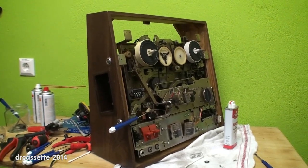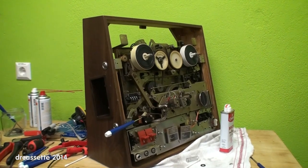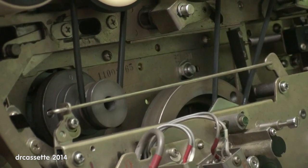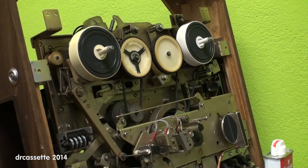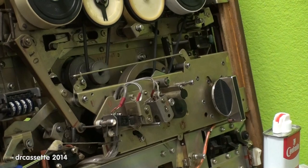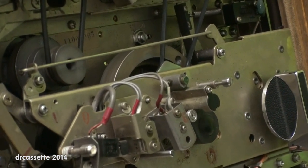As you all know, I'm not much of a fan of Sony, because they tend to have a lot of problems, and those problems tend to be very hard to repair. This one actually appears to be a bit of an exception, at least up until now. Whenever I first opened this up, the capstan drive belt was gone and needed to be replaced — kind of weird, because all the other belts are still there. They are kind of loose and bent, but still working, except for the counter belt, which is looking quite sad. I kept some spare belts, so I took out four screws, the whole head assembly just comes off, and then you can pull the flywheel forward and fit in a belt. So that's what I did.